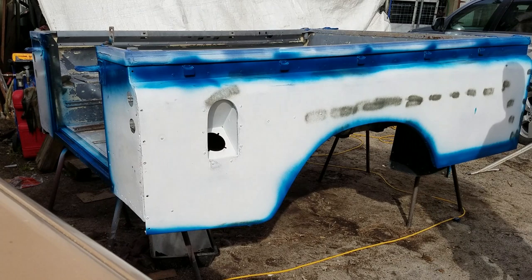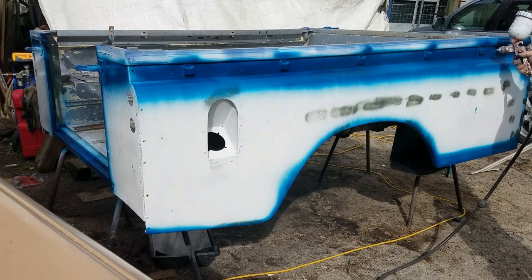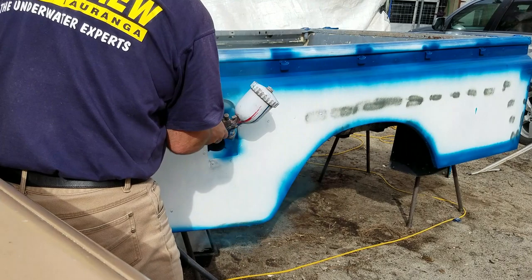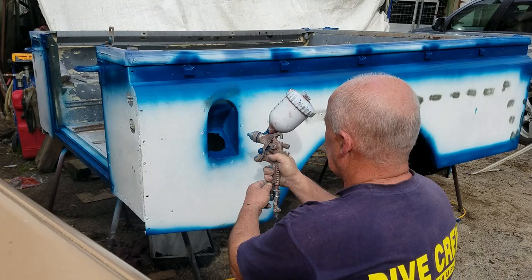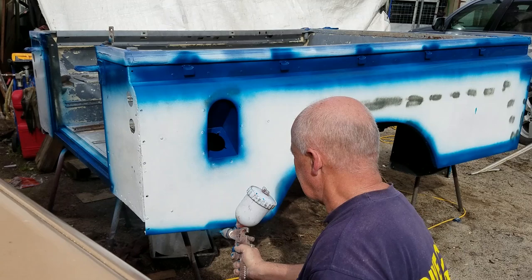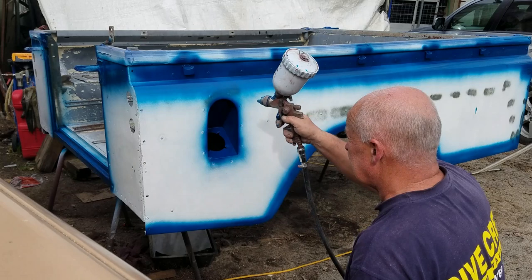Underneath this top rail you've got a combination of needing to spray up to get paint up underneath the rail, and you've also got to get in left, right, left, right behind each of these little rope-down tie tags for the soft top. Getting that out of the way first before you start blowing in the sides is a really good way of ensuring you don't find little bare patches behind those tags after you've painted the entire thing. I've had the gun turned right down to give me about a two inch fan. Now that I've done all these small bits I'll adjust it to give a wider fan and start blowing in the sides. A good gun has an adjustment of between maybe a one inch fan and a six or seven inch fan.